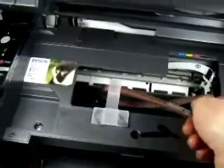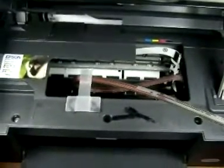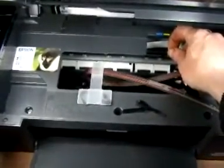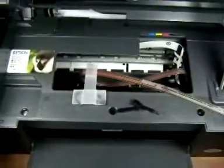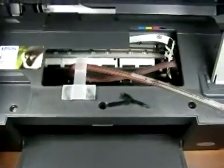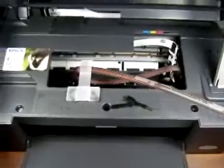There's one more thing — the cartridge carrier. There's a reset button at the back. There's a little reset button that sticks up out the back of the cartridge. If, for instance, your black cartridge runs out, it will say your black cartridge is out or cannot recognise black. All you do is press the button or go through your software to bring your carriage to the change position. Then it will expect you to take the black out and put another black in. But you don't — you get that little button, press and hold it for five seconds, let go, press continue, and then your black is full again. That's how to reset the levels on your cartridges. It will only reset the one that it says is out. If three all of a sudden run out, it will reset all three. But if only one is supposed to have run out, it will only reset that one, and the others at a later time.